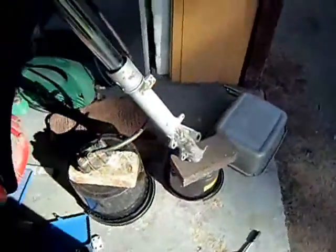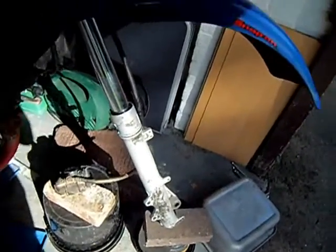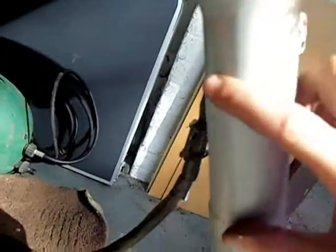If you're out on your bike and afterwards there's a stream of fork oil coming down your fork, and when it's sat there it's leaving big puddles on the floor and on your wheel, then there's an 85 to 90% chance it is your seals that have gone. But if there is just a tiny little line, don't know if you can see that, where a bit of oil's weeping, it might not be the seals.